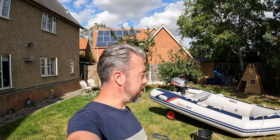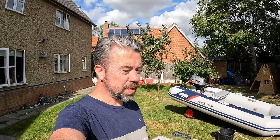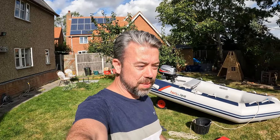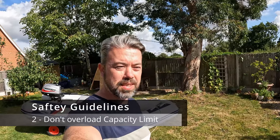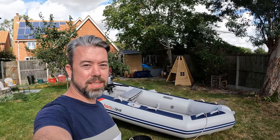We've covered most of the essential equipment. Next I'll talk about some basic principles that apply when you're out on your SIB. First, check your boat before you get out there — check it for any punctures, tears, check the seams and valves, just make sure the boat itself is in good working condition. Also, make sure you stick to the capacity of the boat. Don't overload with too many passengers or too much gear, and make sure you're under the weight capacity of your particular SIB. Having too many people on board could cause stability issues, so don't go over the rated capacity.